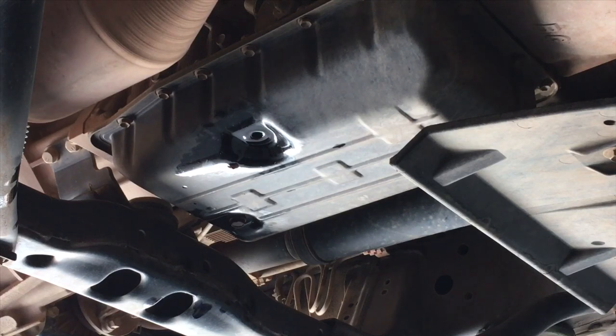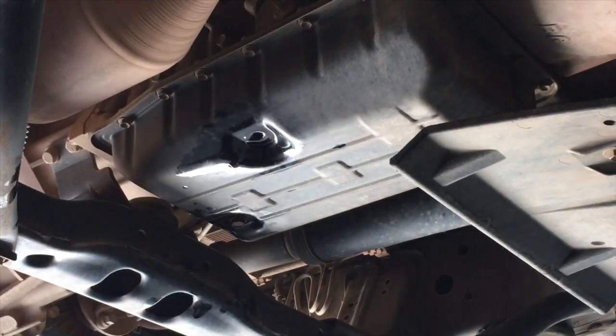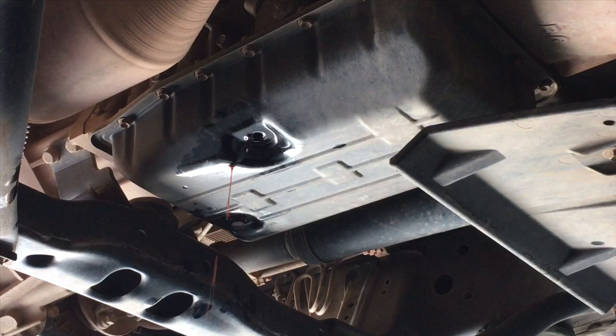At the moment we're on 38.7 degrees and circulating the oil. Any minute we're going to put it in park as it's about to hit 40. Can you please put it in park? We're going to very slowly add the oil, just until it becomes a trickle, or if too much comes out we're going to stop. It's 40 degrees — I'm happy with that. We're just going to fine-tune it and make sure it's spot on. Nice clean oil coming out.